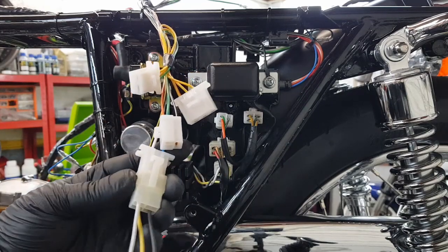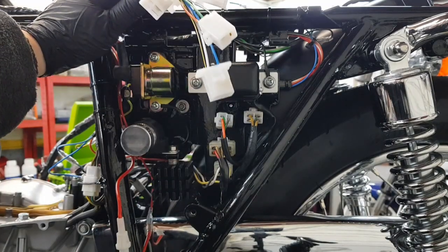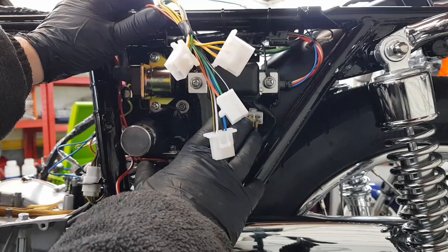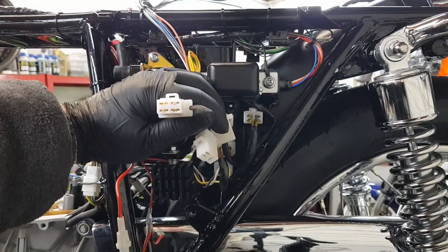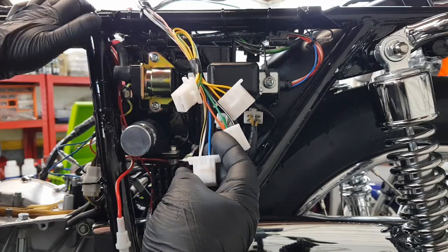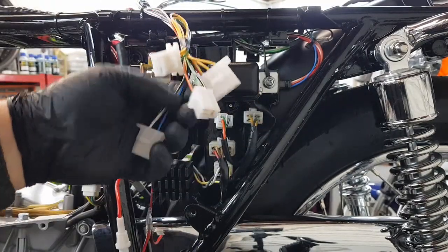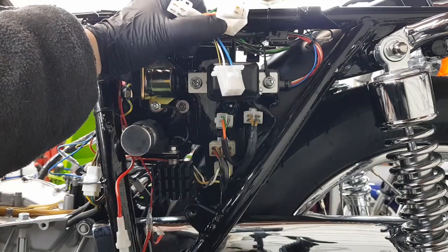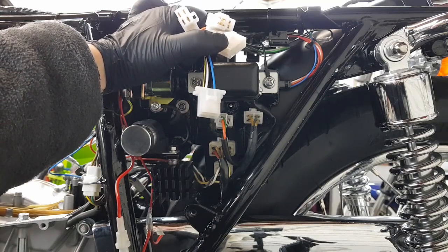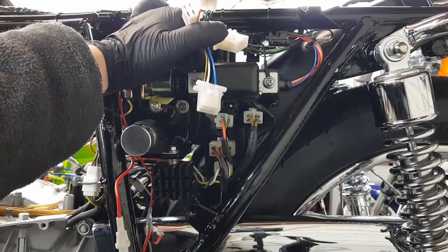And the black goes on the bottom next to the yellow wire — that's all three now in the correct position. If you're retrofitting this to a bike with an old loom, I would take this panel off and just check, because somebody may have moved the wires around in its past. Just undo that, pull it out, and make sure the wires are where they should be. If you're fitting a new loom — certainly with a Bob Harris loom — they're all in the correct places, but it just pays to double check. That way you can't have any mistakes and wonder why it's not running correctly. That's the plug sorted.